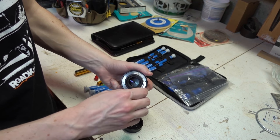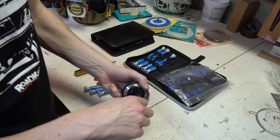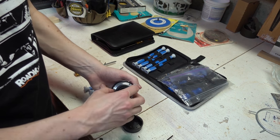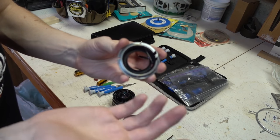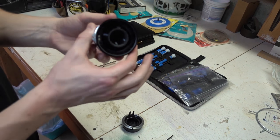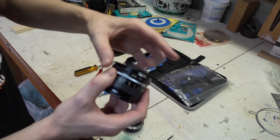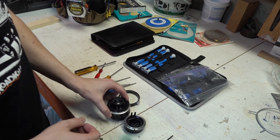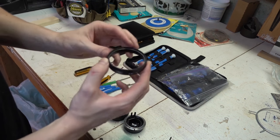This screw right here - my advice would be to remove it last. I'm going to listen because on the 50mm f1.4 I could hear the spring tension leaving and the screw was longer. This is the same length as the rest of them. And then it pops out - there is the spring I was talking about. On this lens it's not hooked up to a screw. I want to be very careful not to damage or remove it. Once that's done you can see the inside of the lens. Some of them have a screw around the aperture ring that holds it into place - this one doesn't. The aperture ring easily comes off.